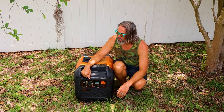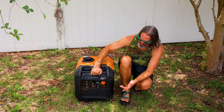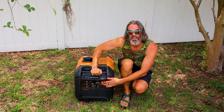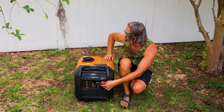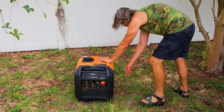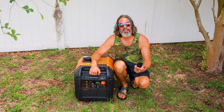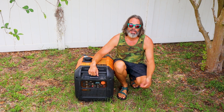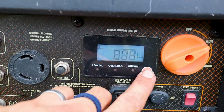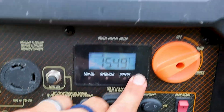The fuel doesn't look too bad but I definitely want to burn it up. Always use a fuel stabilizer and store it with the least amount of fuel possible. This thing hasn't been on since it was pulling long days after a storm, so it'll be interesting to see how quickly she fires up. You put it on choke, turn it on, and then pretty much immediately after it starts running you switch it over to run. Let's see how many pulls she takes. And that is a good generator right there. She has 246 hours on her. Fuel says 100% but I doubt it — probably about 15 hours left.